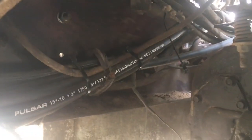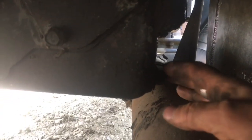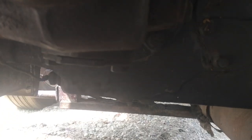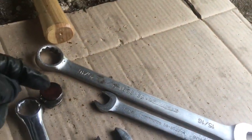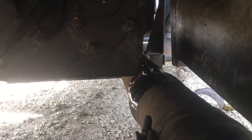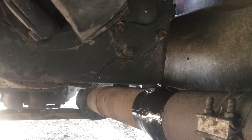While I was down here doing zip ties, I noticed the exhaust clamp was garbage — I'll have to replace that. I might as well drain the oil out of the front transmission too. The drain plug is right over top of the exhaust pipe, so there's going to be oil all over it and it'll smoke when I start it up. Not sure why they didn't put a drain at the center of the back. My loyal dog Biff is supervising. The oil drains like chocolate pudding over an exhaust pipe. I'll put some new gear oil in and plug it back up. The drain plug looks fine although it doesn't look like a magnetic plug — the magnetic one is probably on the fill side — so I'll pull that big plug and check for metal, but I'm not expecting any.